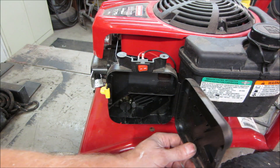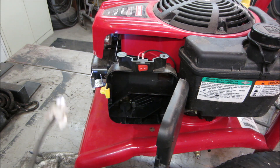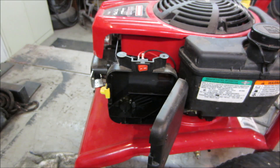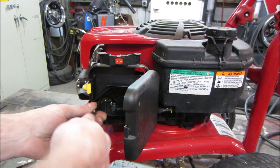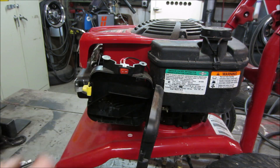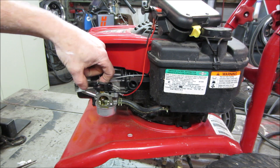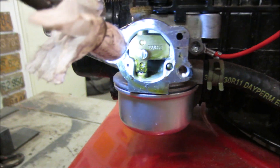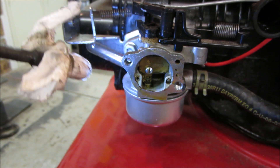Let's get the air cleaner out of it. We see a bunch of corrosion. Let's get this cover out of our way — we've got two screws right here. Let me get them out so we can get the cover lifted up. I see some residue coming out of there. It's like either the float needle got stuck and it overflowed with gas. Let's get the bowl off of it — that's really going to tell us.